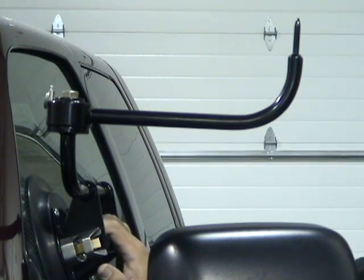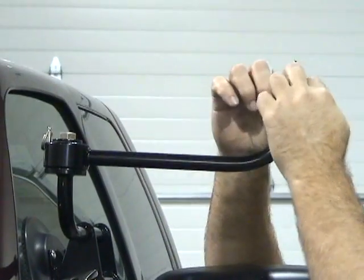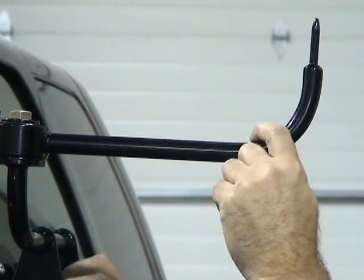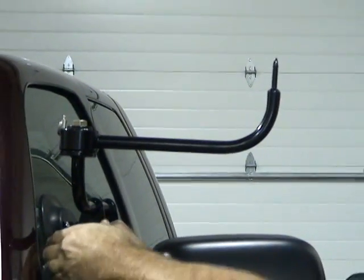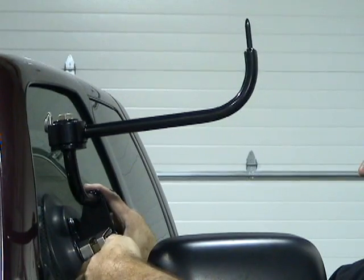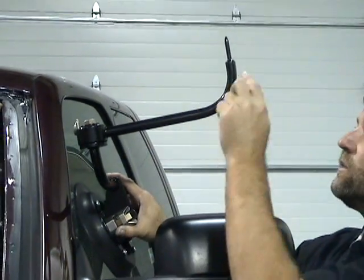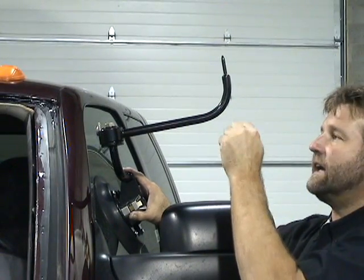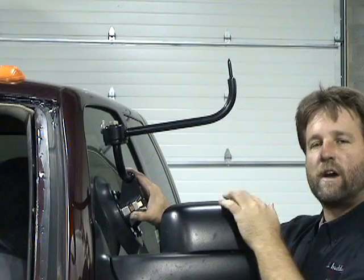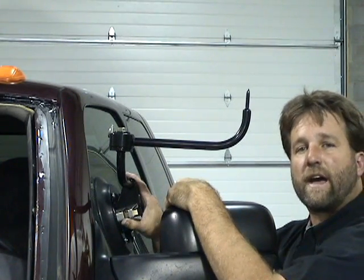So imagine what would happen. Picture the sliding rod attaches to this post right there. Now, as we release the cup from this door glass, picture another 10 or 15 degrees of angle on the door glass. What happens to this post? It just raised 3 or 4 inches. So we need you to understand that when you're setting up the base cup on the door glass.